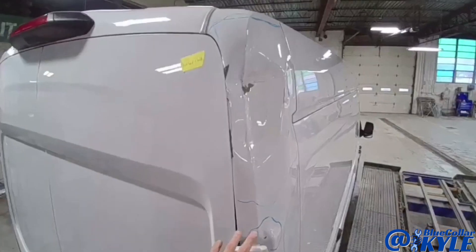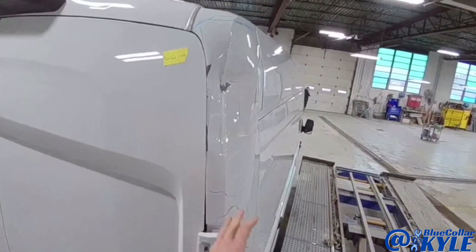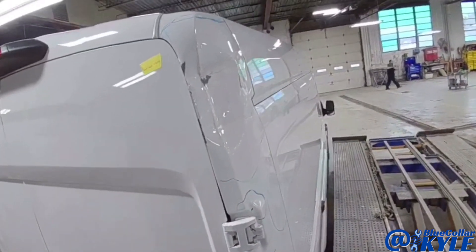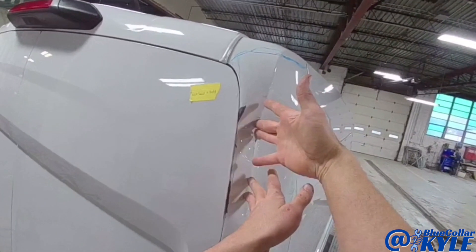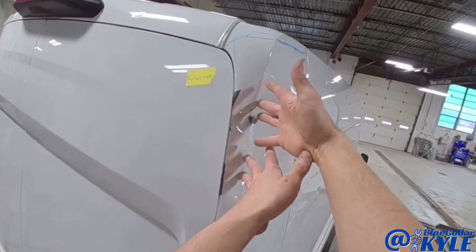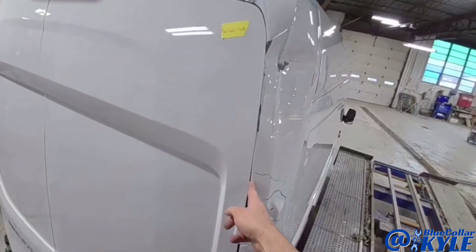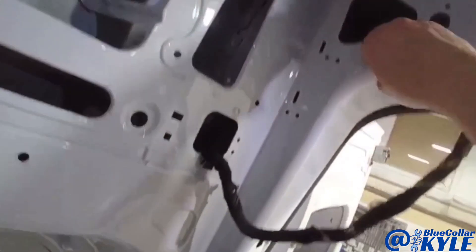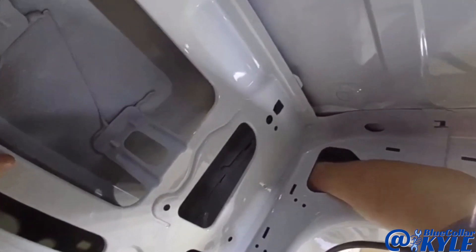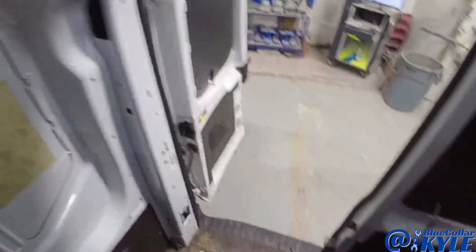It's crushed. What I'm gonna do is first look and see what kind of access I have from the inside. I don't believe there's much, but I'm gonna see if I could get to any of it from the inside first. Then, depending on how that goes, I might have to weld some tabs right here to the edge — I probably will, actually — in order to bring that out. Once I bring that body line out and it brings all of this back to where I have a normal gap at the door, I'll be able to work the rest of the metal back into shape. Looking inside, I can get back behind the damage but there's no way to really get any leverage. Looks like I can't do much from inside, so I'm gonna have to weld tabs on the outside in order to bring that out.